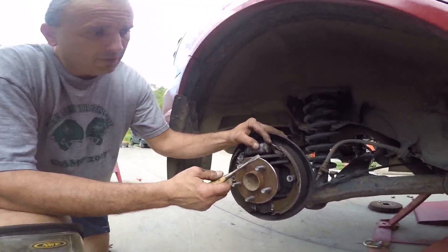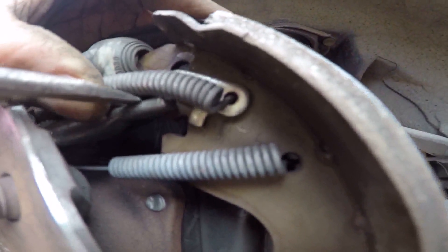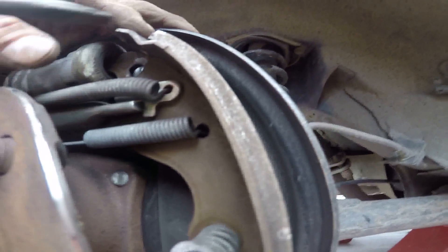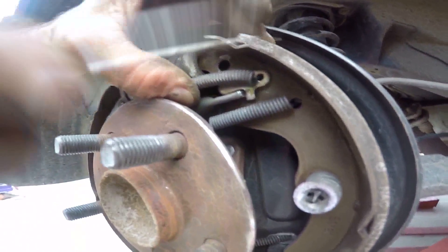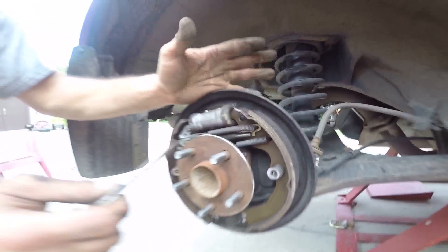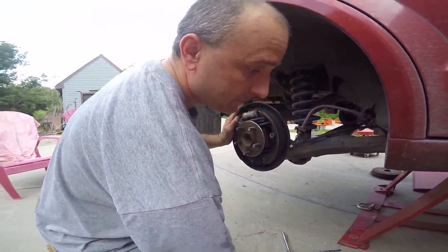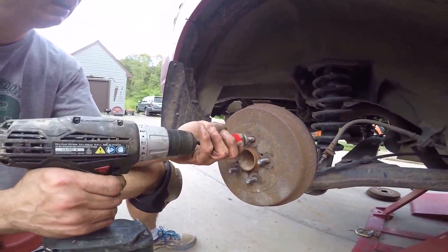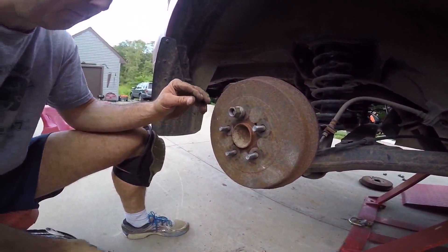We found the problem. In its current state the adjuster should be in this groove, but it's pushing up on this lever instead of sitting down in its slot. You can see — this is the way it should have been. I was actually driving around with a brake that was kind of a quarter of the way pushed on the whole time. So now I'm going to slide this drum back on, slide a nut on, and give it a spin test.